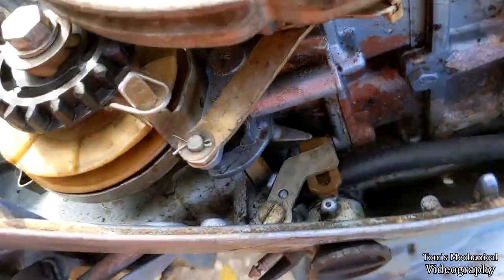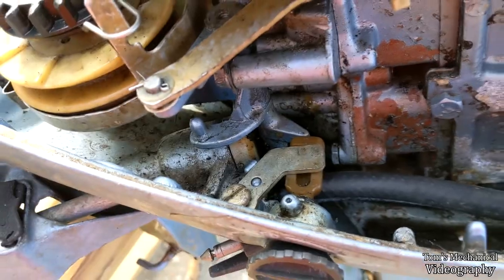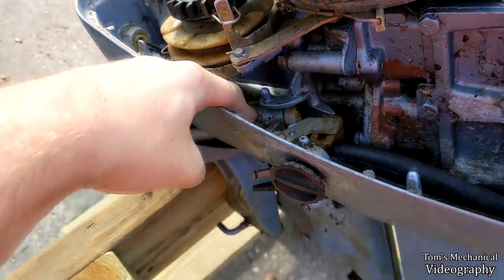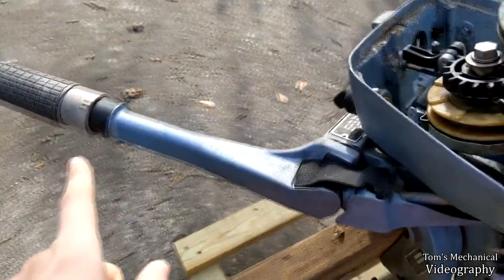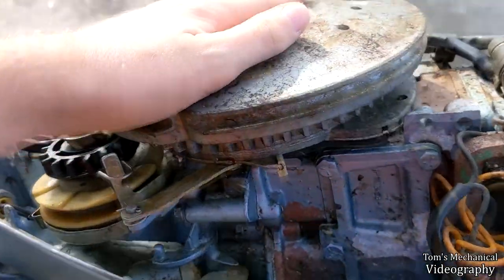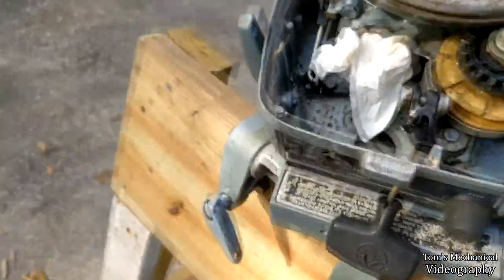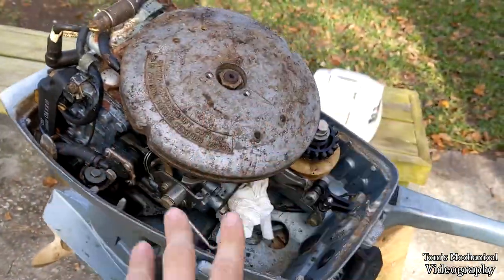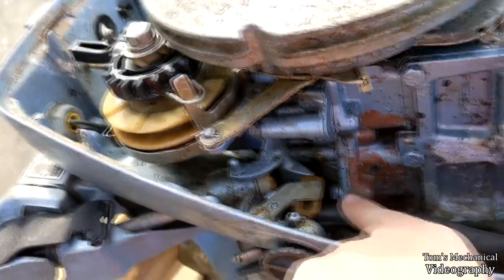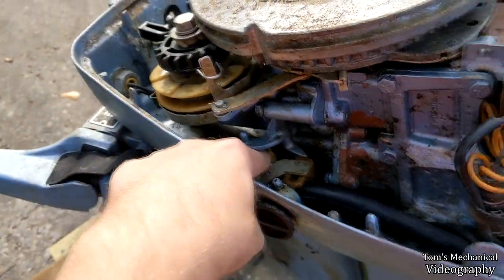When we look down in here, we've got nothing moving. The problem is that gear right there is seized inside of this aluminum housing. So no matter what I do with that tiller handle, the accelerator doesn't move. I've already removed this pin, and the whole accelerator linkage down here works just fine. All of this over here is totally free — not an issue. That gear down there is even free. It's just this one that is seized.